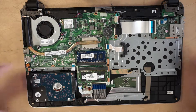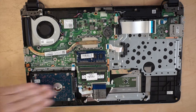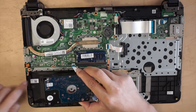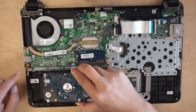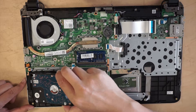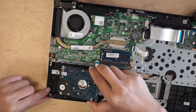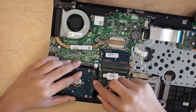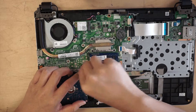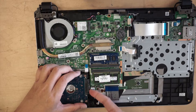So here is the hard drive. There is no screw on the hard drive — you can just remove it by sliding to your right and lifting it up at the same time. This is where it latches onto the bracket. If you want to put it back in, make sure you match the bottom line on both sides, slide to your left, make sure it locks in on these two parts, and then push it down. Flip open the latch and you can remove the hard drive.